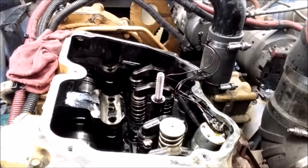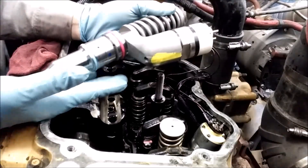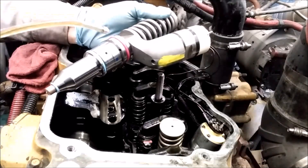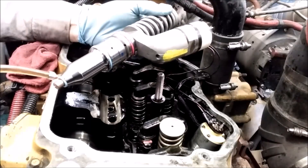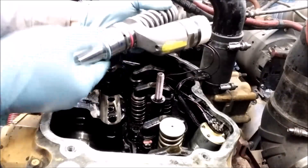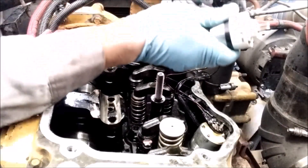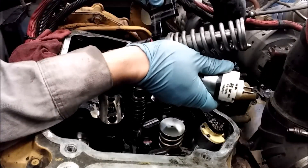I've already reinstalled the number two injector. Here's your number one injector. Make sure your seals are okay, they're in the right place, and they're not damaged. Then you're going to lubricate them with engine oil — just coat them, it doesn't have to be dripping. You want the injector to be coated in oil to help when you seat it, so it doesn't catch on anything and cut. If it does, you're going to have to pull it back out. As long as they're lubricated, I've never had an issue with them breaking when you go to seat them.